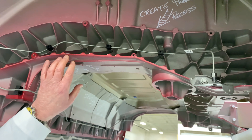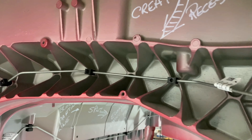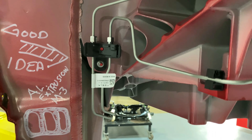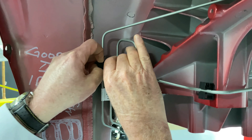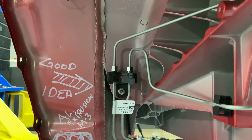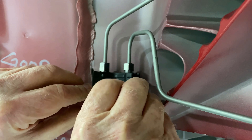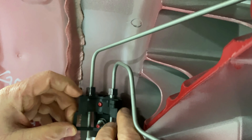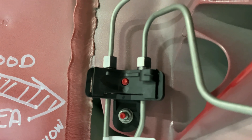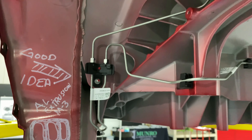What's nice about this mega casting is these nice recesses — exactly what you'd want if you're routing things like brake lines. One cool thing we found was this little connector right here. You can put it in place and hold it with this little u-clip, which is a handy aid for the guys trying to install the brake line during the assembly process.